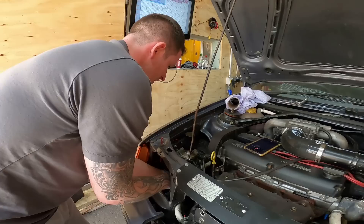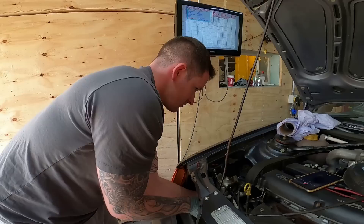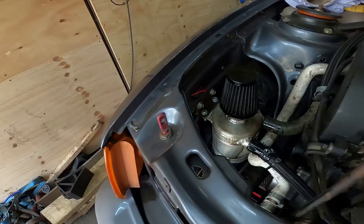I said to Jamie when you fit your breather, make sure the fitting on the bottom of the breather tank goes to the fitting on the front of the block so any oil in the tank will trickle back down.